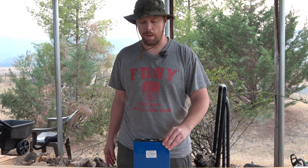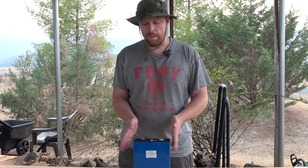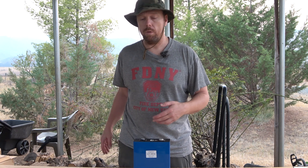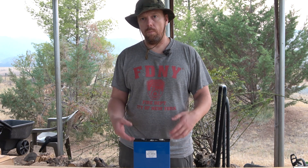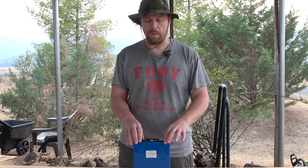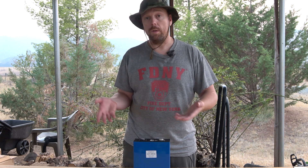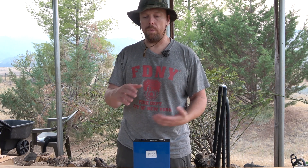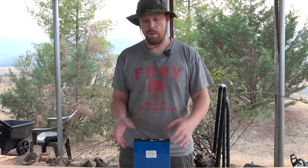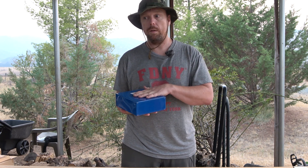It's quite impressive how far lithium iron phosphate chemistry has come. The old CALB and Thunder Sky LFP cells aren't new to the DIY EV conversion community. What's newer is this hardened aluminum casing — the old nylon-cased cells would expand and degrade over time. We've seen many Ford Ranger Electrics upgraded with nylon-cased cells that just died, leaving owners with 1,100 to 1,300 pounds of worthless lithium batteries.